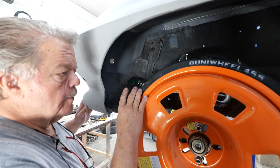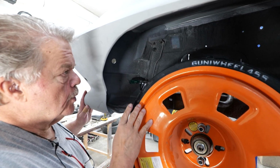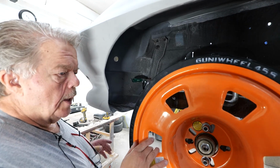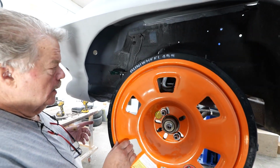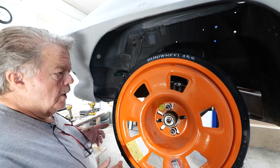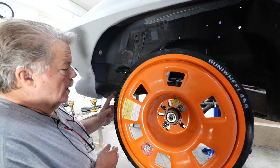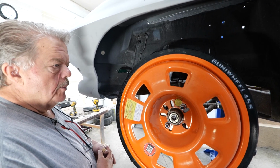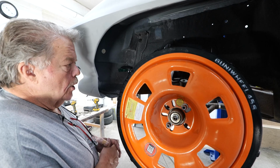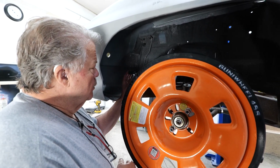Fitting the hood with the inner fenders in place and getting the inner fenders to fit perfect and to get the hood to fit perfect before you glue it, okay? If we glue the inner fenders in here, and we all know these cars are different, and then you get the front end to go put it on your car and you're off a quarter of an inch on one of your bolt holes, you're gonna be calling me up and asking me why. And this is why we don't glue them in, because it's pretty simple to do, okay?